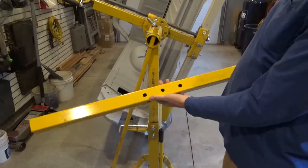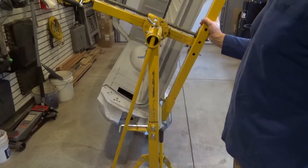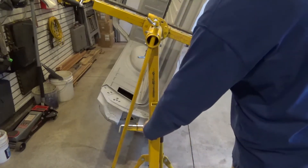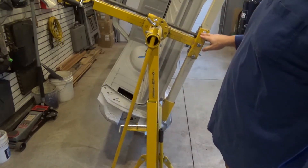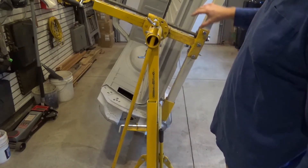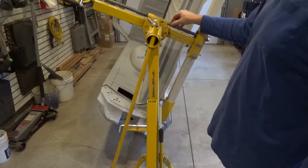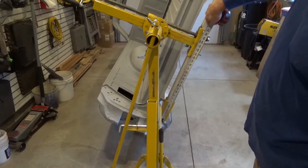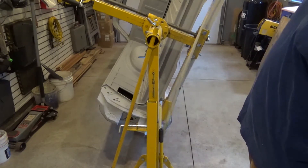As I mentioned, this is the support that came with it — it's just too short. So I had to buy some square tube. I used the original as the template. I had to drill six holes to get the lead screw in there. For this body — an A-body Chevy — I made it 45 and a half inches.